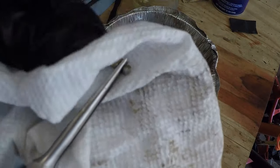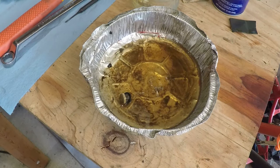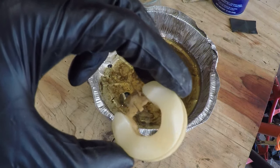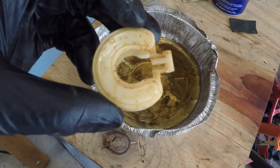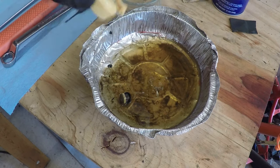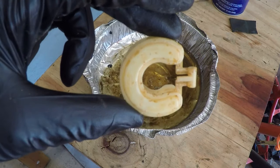I think that this needle looks pretty good. The sealing surface is really what I'm concerned about — it's not scored or anything. Looks very good. All cleaned up. The varnish was really stuck hard on this float. I cleaned it off as best I could. I could put it in an ultrasonic cleaner, but this thing floats, so I let it soak in some mineral spirits and carb cleaner. It's a float — it still floats, it'll function regardless of how it looks. It's more about functionality than looks at this point.